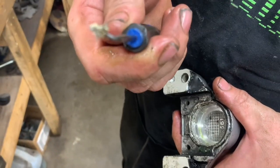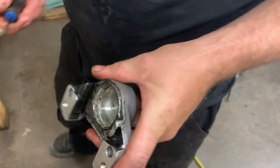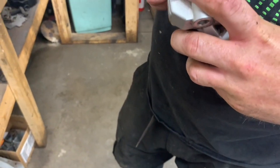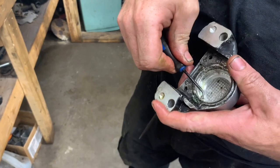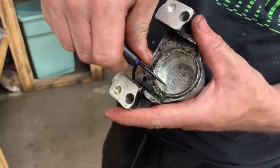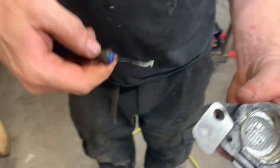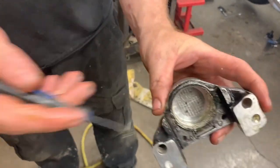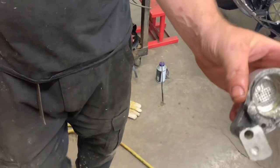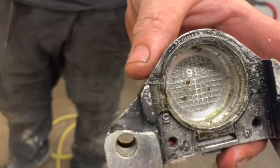This happens with cars and stuff too. People ask you if you want your brake fluid changed. It's not always a scam. Sometimes these are $600-$700 a piece times three, and then the same kind of thing goes on in the master cylinder sometimes. So bottles of brake fluid are pretty cheap compared to that. Yeah, for sure. The idea is if you do it every 2 years, this never happens.